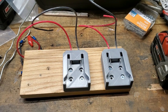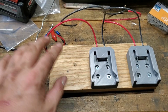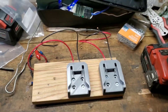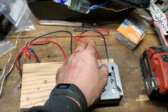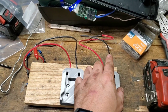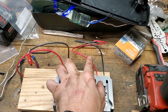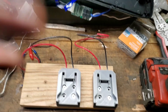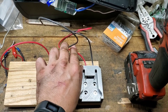I've got two of them screwed down with two screws each. The third one — I've mocked up where the holes needed to be — I won't mount that until I get over to the bike because it's already been hardwired in. Now I'm going to shorten up my wires and connect the positive to the negative on one side. So we'll have the negative free to go to the negative on my controller, these two wired in series, and then my positive free on the other side — giving me my 36 volts in series. I'll go ahead and snip these two wires down and show you how I'm going to put them together.